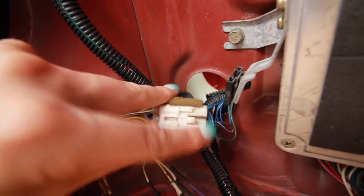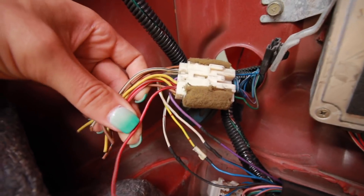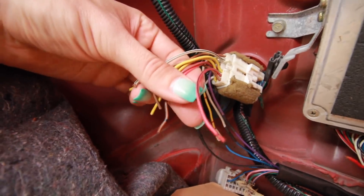If you don't have that ground, the relay never closes and the fuel pump relay never gets power. Right here — green wire with a red stripe in the EA-1 plug, and across from it is a red wire with a black stripe that is cut, which needs to go to the ECU but doesn't. Dave's thought process is to delete anything not needed to make the car function; I want things as close to factory as possible. But bouncing those different ideas off each other actually helps a lot when troubleshooting.